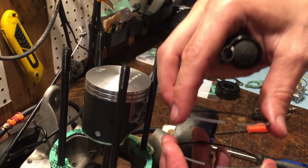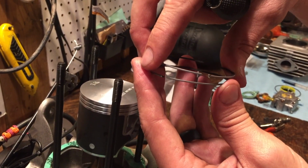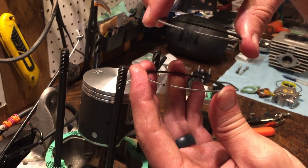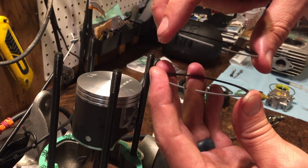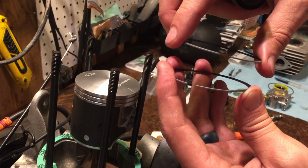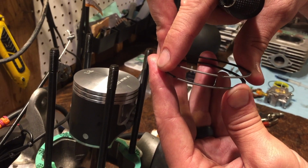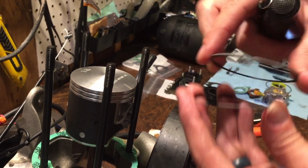You've got two pistons there, working up and down like this, and they're offset a little bit. Sometimes you guys have a ring that you didn't put on right, so the ring will slip around and that scores the side of your wall and it seizes your engine. That is a real common issue that I see. I've literally rebuilt probably 100+ Moster, just paramotor engines in general. The most common thing is the piston ring should sit in there like this on the pins, and they're both in the same direction when I pull them apart. Anyway.